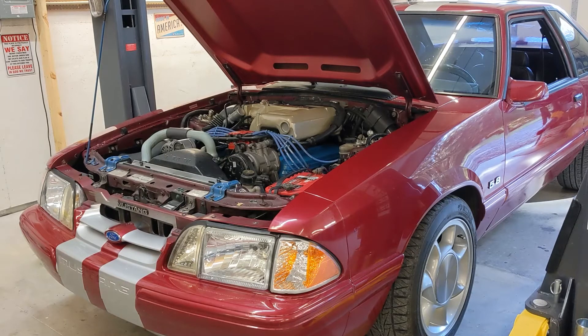I've been tinkering on this car since 1997, and right now it gets about 12 miles to the gallon. She is running super rich. I don't know if it's the mass air meter and injectors that I bought years ago that didn't match up correctly, or I have no idea. But at any rate, it's running very rich.